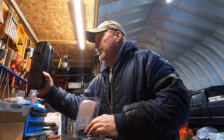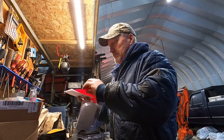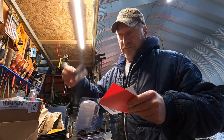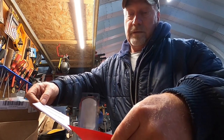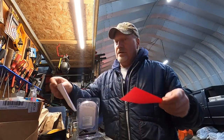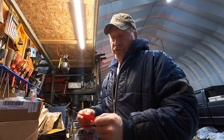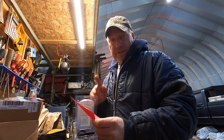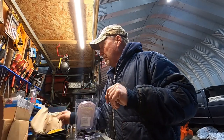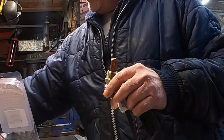I've got multiple small projects to get caught up on. I got this tag on the new heater and it says right here: do not plug the heater in before installation. Dry firing these block heaters will damage the element. Keep that in mind if you get one — I didn't even know that. So there is our new block heater.